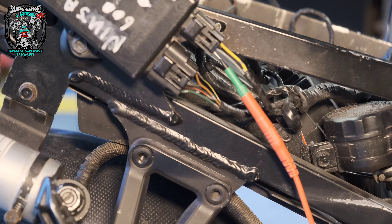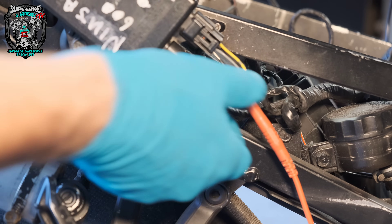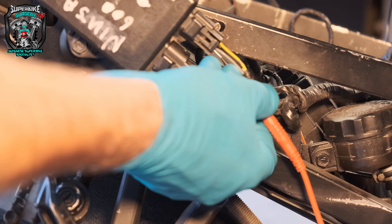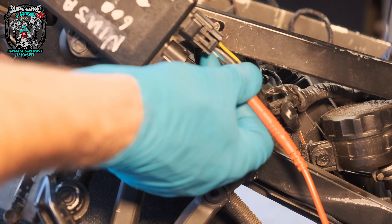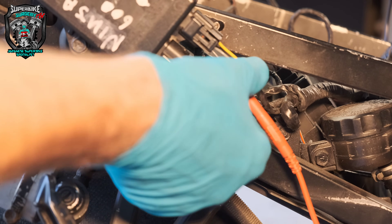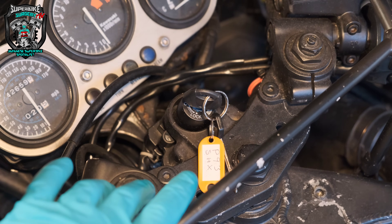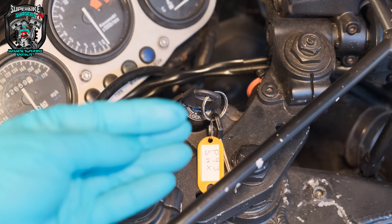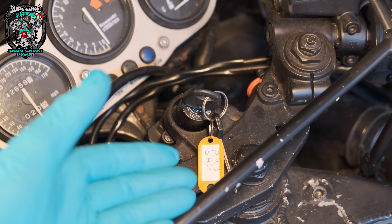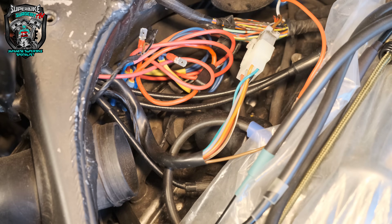12.82 volts — it should be 5.5. It moved a bit when I wiggled the wire. That's why this bike won't start — because that number is wrong. The most likely culprit is this aftermarket ignition switch. That does beg the question: why did it stop running in the first place? I think the reason for it not running all the way back then is lost in the mists of time, because it's been messed with by so many different people.